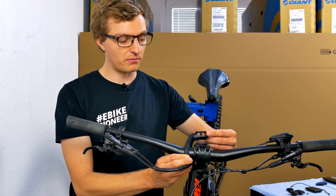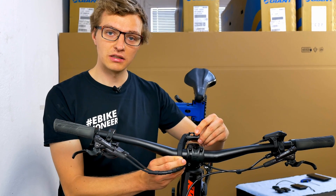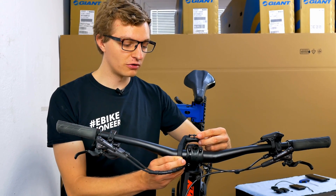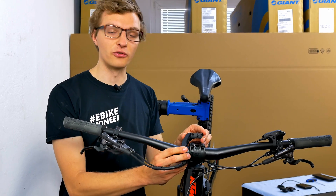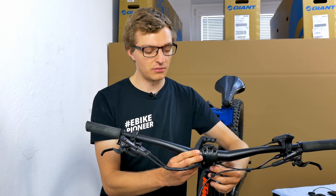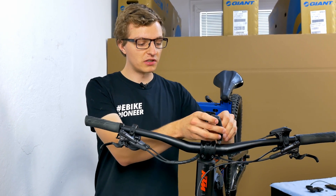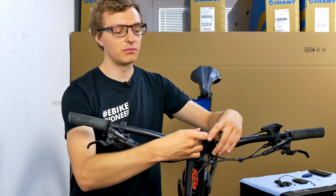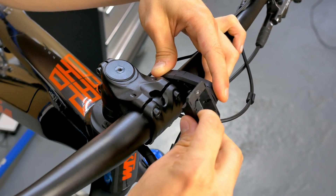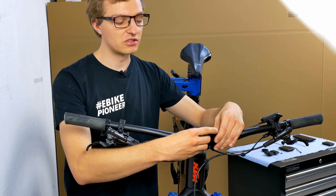Once you have made your decision, you need to pay attention to where the display cables come out at the end of the holder. Because this mounting bracket on the single arm holder only has the recesses on one side where the display cables can be inserted. So if we mount the holder like this, the display cables would come out towards the front in the direction of travel. This makes sense if the display cables are routed into the frame under the stem. Likewise, if you mount it the other way around, the display cables will come out towards the rear. And then you have to check how the display cables are routed past the handlebar or the stem. Here you also have to pay attention when selecting the correct display mounts.